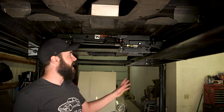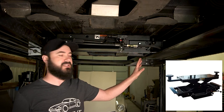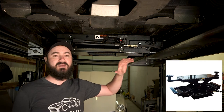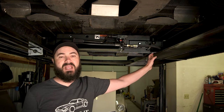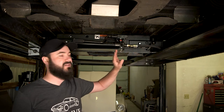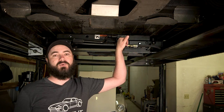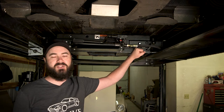This jack has some adjustability to fit on various lifts. The arms slide out side to side and have smooth contact pads on them to make it easier to slide up and down your rails. However, because of where the boxing fits, it may not fit every lift. When I purchased this, the vendor on Amazon reached out to me to make sure it would fit my lift. I would recommend looking for a fitment guide to verify your rails won't interfere with the body of the jack.